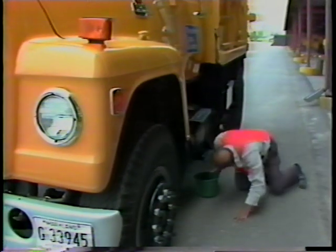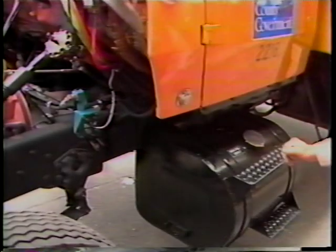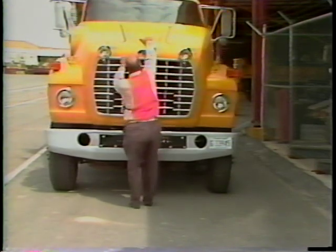Now we are down to our last two pre-start checks. Before you start the engine, you should drain the condensation and sediment from the fuel tank. A drain cock is provided at the bottom of the fuel tank. Open the drain until all condensation and sediment have been removed. Be sure to close it. Never perform this operation while smoking or with an open flame in the area. You must also drain the condensation from the air tank. Overnight, condensation collects in the air tank. This moisture can cause serious damage to your brake system if not removed daily. Open the drain cock until the condensation has been removed, then close it. Use caution when working with air under pressure. Before we go on to the equipment warm-up activities, you may wish to stop the videotape at this point and review the inspection steps.